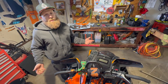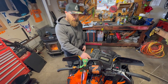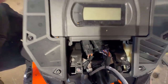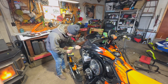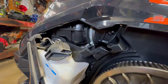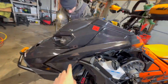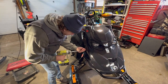Part of the front bumper install requires pulling the front plastics off and the exhaust. The first step is removing this little piece here — just push down and pull up — and then remove these two bolts. Next, remove your side panels and pop off the air intake clamp. Then we're pulling out the bolts up top so we can get the hood off.